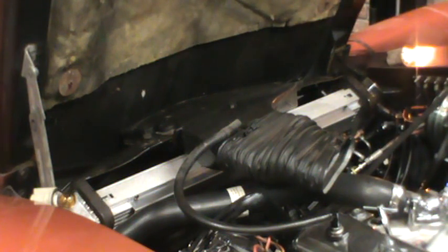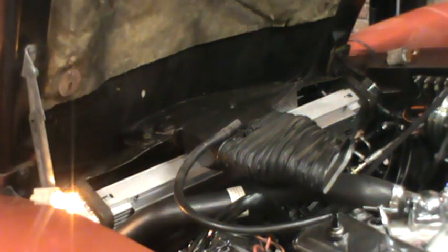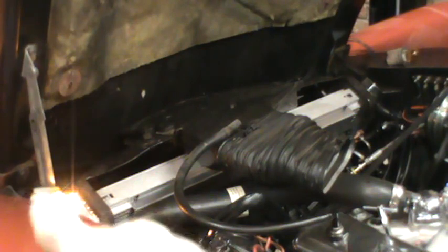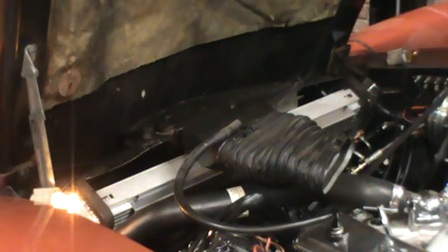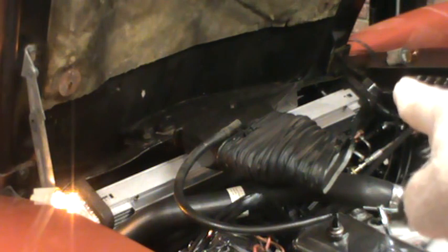But I got my ohmmeter out and I started checking continuity to ground, and I had a good ground on that. Okay, but the second thing, just to show you what we showed before, is I turned the parking lights on. It's a little bit different up front. The parking light on the driver's side, which you can see in the bottom part of the frame over there, comes on, but the one for the passenger side does not.